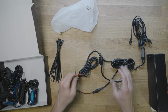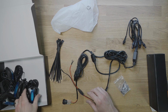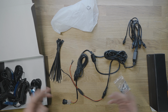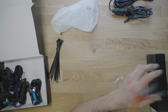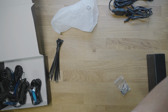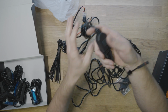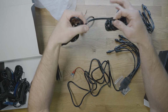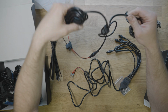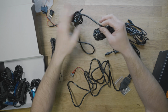Personally, I'm always not a fan of these harnesses that are included. I think that sometimes they're the failure point of these products. The lights themselves can be pretty decent, but the harnesses aren't as good. Because I got an 8-pod kit, I got 2 harnesses, which meant that I could cut one up with basically no negative effects. So that's what I did. Right where the harness ends, at this 8-prong end, I went through the middle of this, and then I came right into here and I just cut it. Because the switch and the power I don't care about, since we're gonna have that all contained, I just cut this right here and threw all that away.